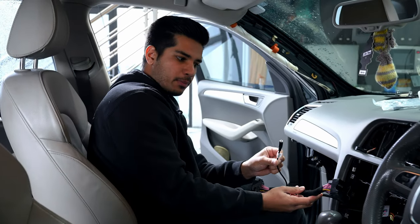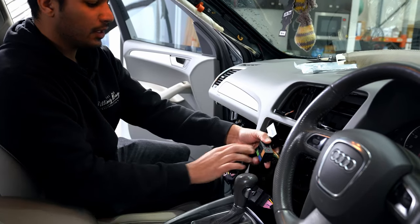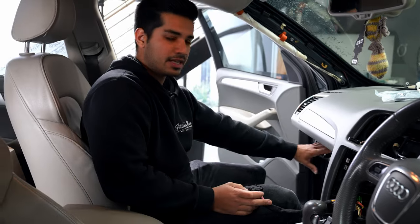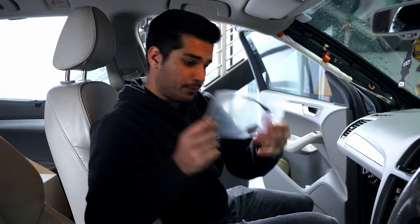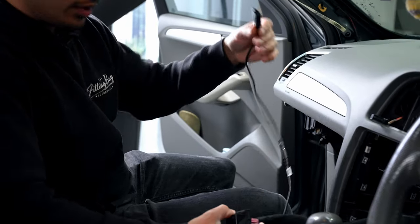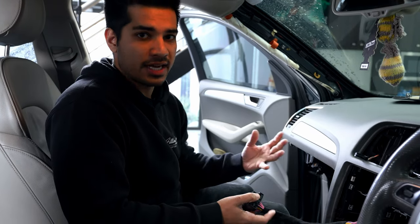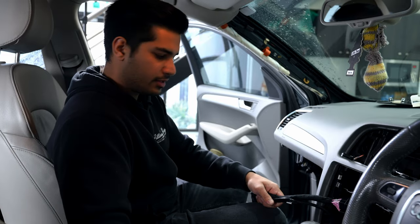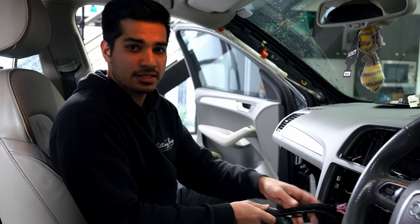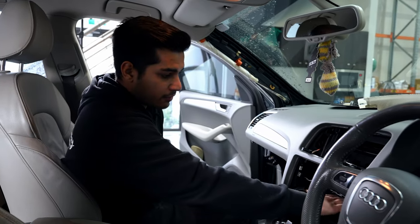Now for the sound — you can see there's a spare port here and we have a quad lock connector. One of these plugs is the AUX input to the car, so it's going to be hardwired into this new screen system. But if the car has AMI — this car didn't — this adapter will come in the kit; it plugs into the AMI and gives you an AUX out, and that AUX needs to plug into this connector. What happens if you leave it hardwired is that it can create interference and the sound quality isn't that good. So if you ever read online that the sound is bad on these systems, it's not — it's actually really good; it's just that people don't know how to fit them properly. In this car with no AMI, AUX is going to sound fine. If you do have AMI, we highly recommend plugging it in that way — otherwise there's a 50-50 chance it might sound fine or it might have interference.